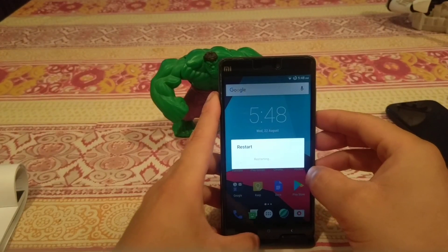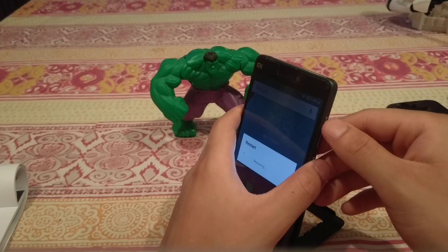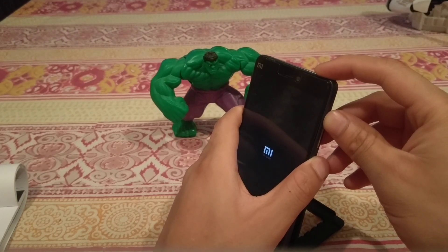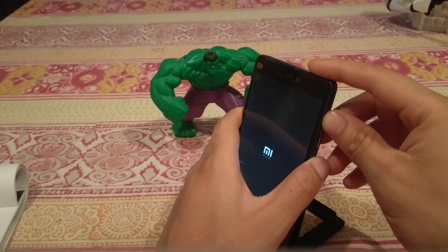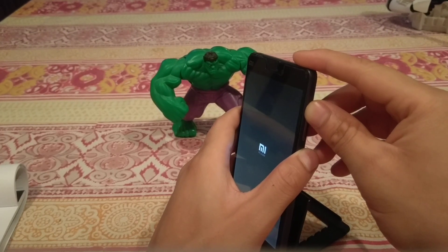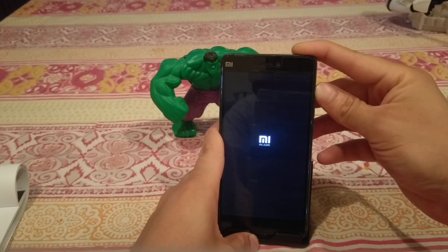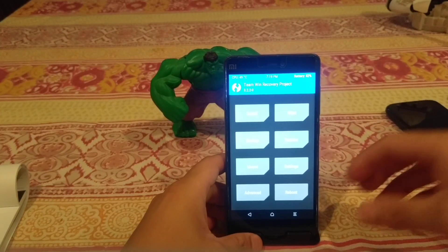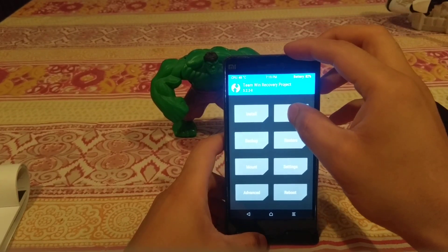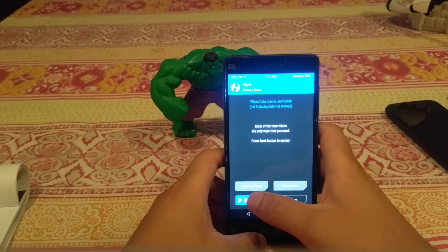You want to power off your device. I've done a video on how to unlock the bootloader and install custom recoveries on Xiaomi devices. The Mi4i ships with an unlocked bootloader, so you don't need to worry about that. To boot into custom recovery, hold the power and volume up button. This is the custom recovery - Team Win Recovery Project (TWRP).